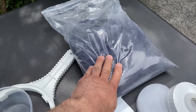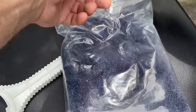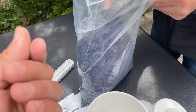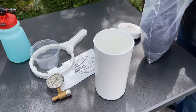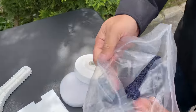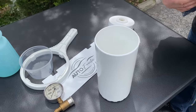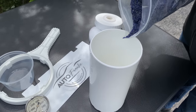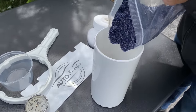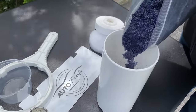There are all different medias you can buy. This one is a mixed-bed color-changing resin — you can see it's kind of blue and gold. We're going to show you how to fill it. It's a little wet — is it okay to touch? Yes, it's fine, it's just a resin that's always moist. You never want to let it dry out. The color will change to a reddish color when it's expended.